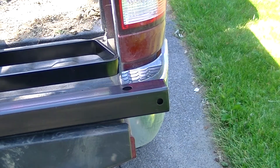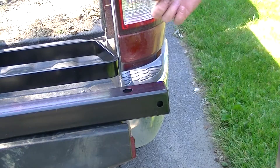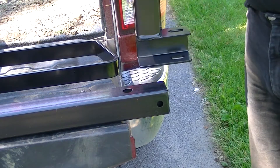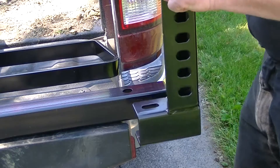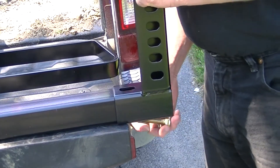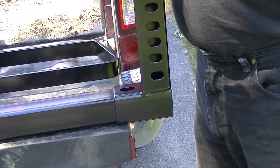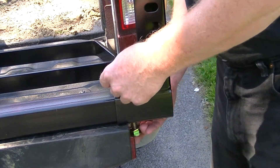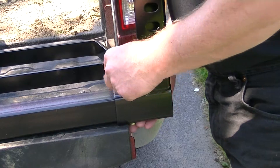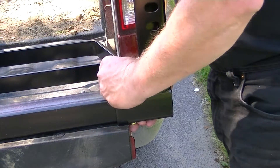I'm going to put these mounting arms on. Since these bolts are too long to put through the hole when you've got this mounted to the cab, you'll have to put it on the ear first and then put this up on the cab. Take the big washer and pull it in there - it doesn't quite fit over that, but it might pull down once you get it tightening up. It calls for a lock washer but they've given us nylock nuts instead.